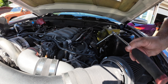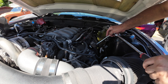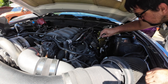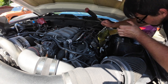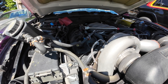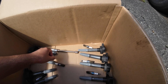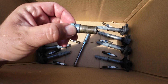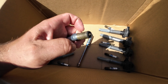Keep the spark plugs in order for consistency. Pulling the spark plugs also lets us see if any of them are fouled — if there was excessive blow-by in one cylinder it should look different than all the others. This one looks a little oily and smells mostly like fuel. All the spark plugs look pretty consistent so far — there are chunks of anti-seize left over on the threads. They all popped out pretty easy, so make sure you put anti-seize on your spark plugs. None of them look extra oily.